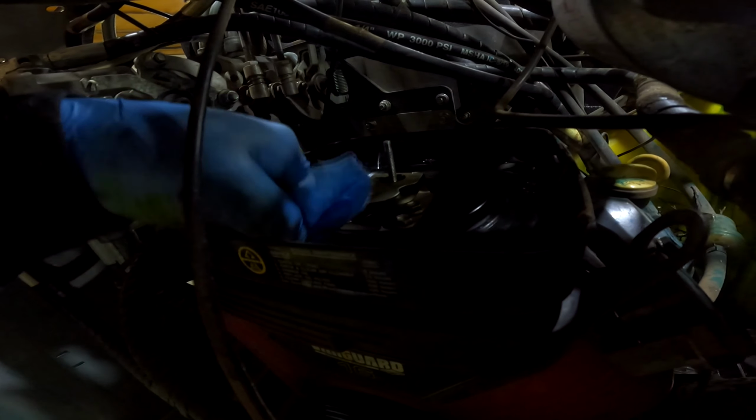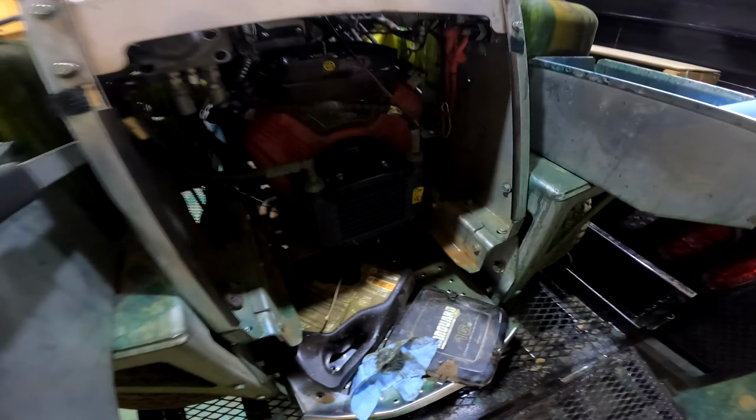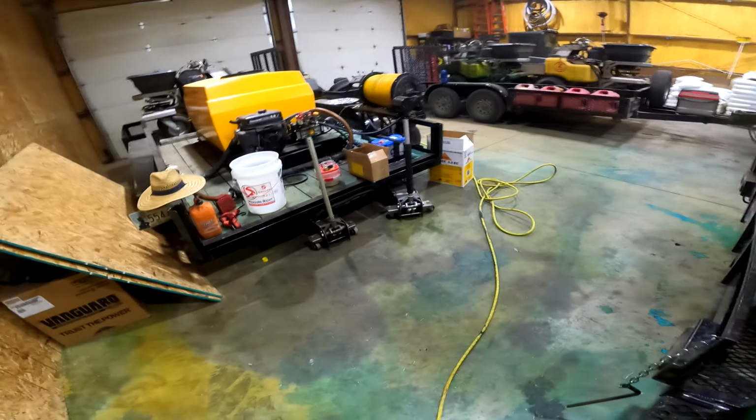Okay, with a clean paper towel, I'll just scrub up here if there's any oil or anything like that. See all this? That's basically everything that's up here. And after I've done that, again with the blower, and that's it. That's how I clean this air filter.